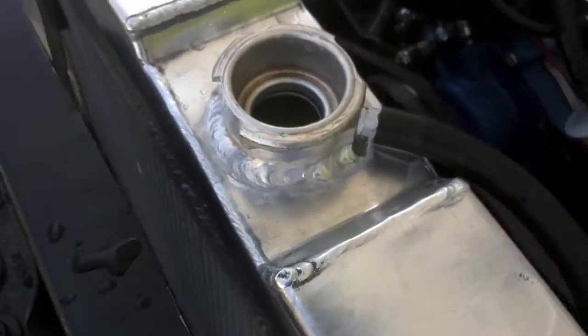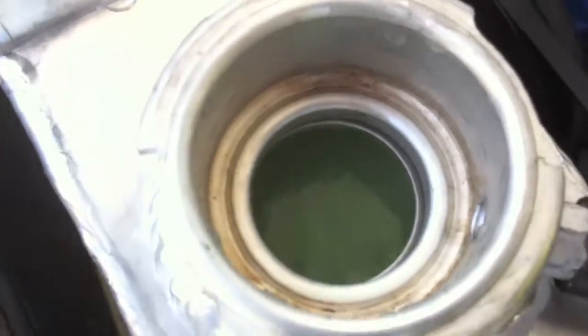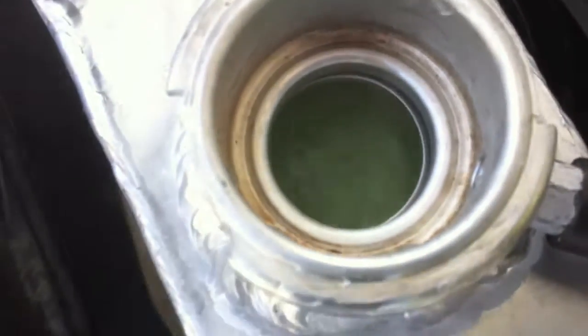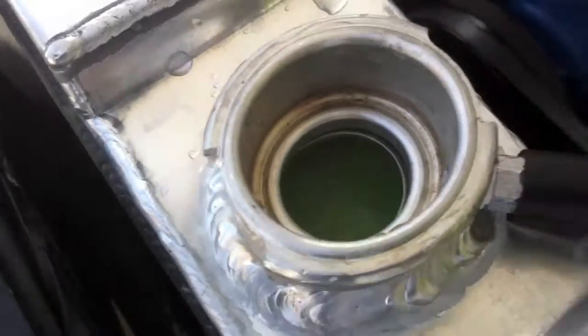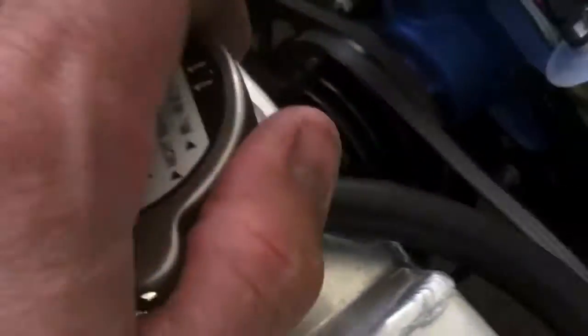Carlos, hit the gas a little. It looks like the thermostat is opening up and we have flow. Never mind, Carlos, you don't need to — we've got flow and the thermostat's open. Now all we need to see is that fan kick on and her not overheat, and then we know we're working. We're just waiting for that fan to go on.